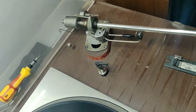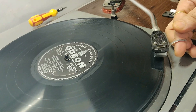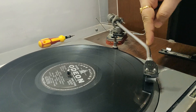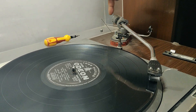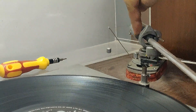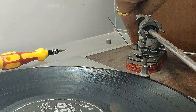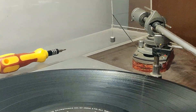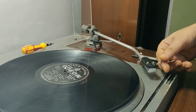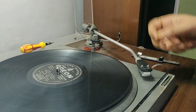If you go to SME in the manuals, you will see that when you keep your tonearm like this, it should be perpendicular to it - it should be 90 degrees. Accordingly, you will see the hook up or back. You will see the nut in the collar. The nut is tight. So I have actually achieved my tonearm balance.